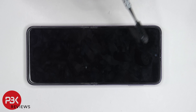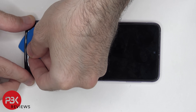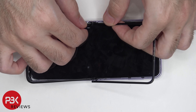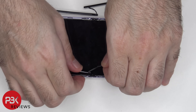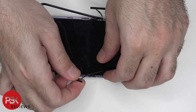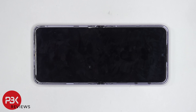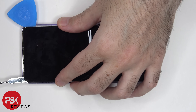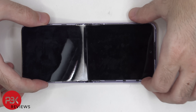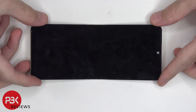When it comes to removing the foldable screen, the borders around the screen are held down with some adhesive, so we need to apply some heat and pry those off. Here's that plastic border. There is adhesive underneath the screen holding it down as well, so I have to apply heat to it and gently pry it off. Here's a look at the screen once it's peeled off.